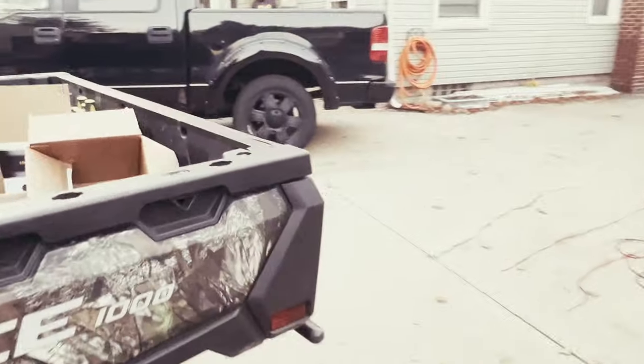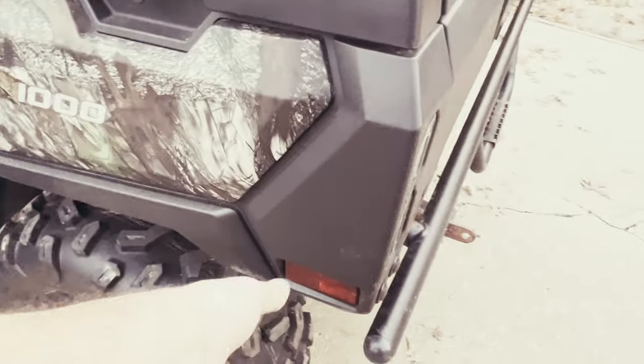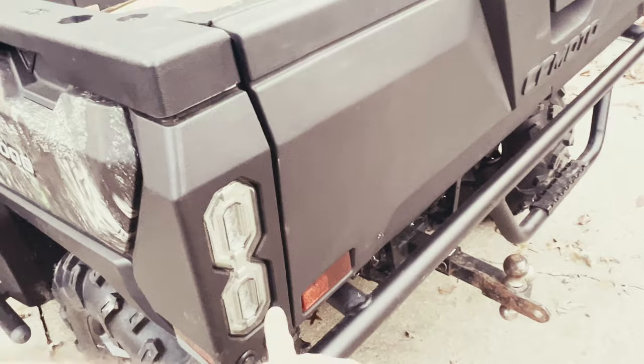And you're going to want to look for in the harness back here, orange wire on this side, orange wire to be in the harness going to the tail lights. So orange wire on this side and a baby blue wire on this side. It's super easy, guys. And then up in here, the harness for your headlight, it's going to be a baby blue wire on the passenger side. You just want to cut it and tap in there.